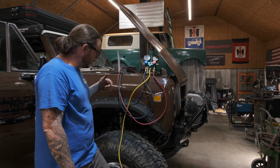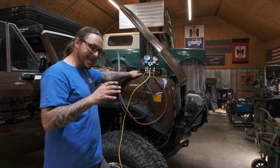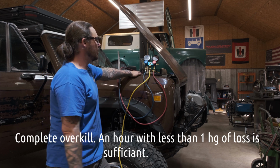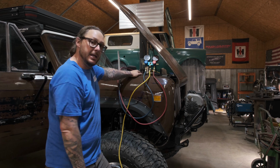So we're gonna let this vacuum run, like I said, for about 2 hours, and then once we get that all back down, we'll shut the system off, and I like to let it set overnight for at least 10 hours. Come back, if we're still on hold in a rock solid 30 HGs of vacuum, we know without a doubt that there are 0 leaks on this system. So nothing to do now but let that happen.